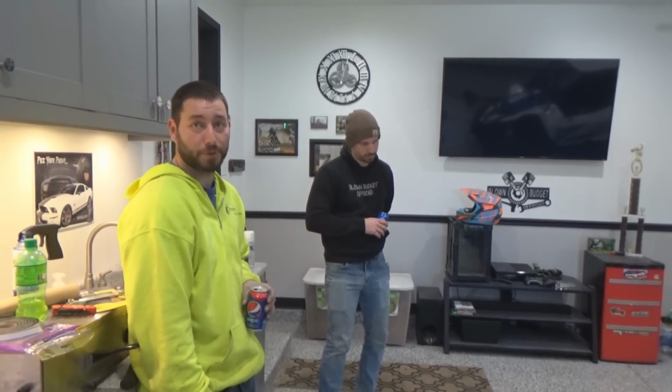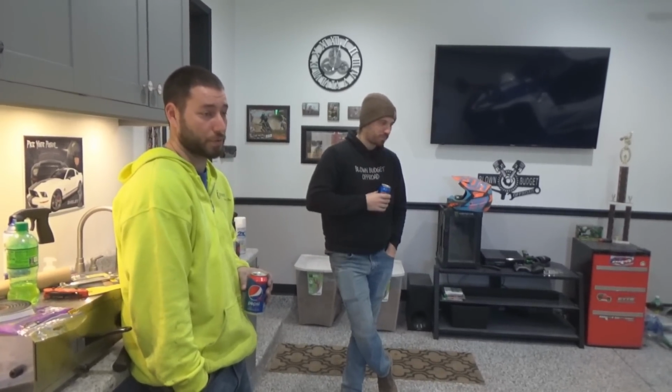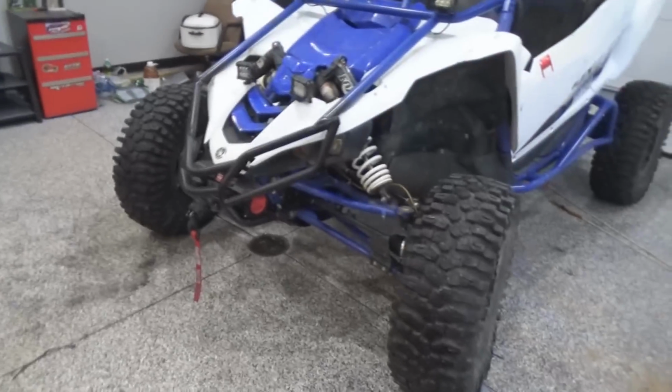Everybody knows the front diff in four-wheel drives is an open diff. But with the added portal gearing, for whatever reason, in a straight line in the snow, it doesn't spin both tires. It spins one, always just one, and it's super easy. Like one tire at idle speed, it'll spin. The diff action really is strange, super open. And don't ask us why or how that works, because we don't understand how adding portals made that worse, but it did.